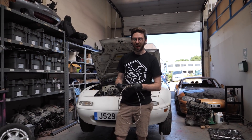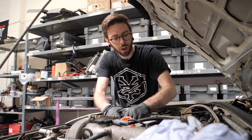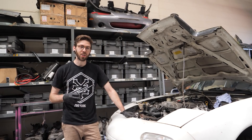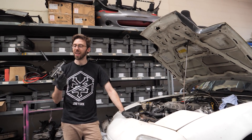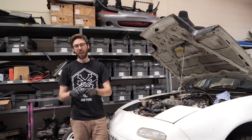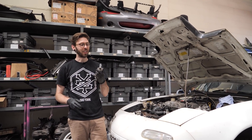So we're back again today and it's time to start fitting all the oil and water lines so we can actually make some boost. So we're going to prime the oil line for the turbo - I'm not sure whether it's probably worth it for a £110 turbo, but in terms of best practices we will do. So I've just found that there are two different holes in the same area which this can be threaded into, except it can't because the thread is completely different and I have completely ruined it. So top tip - make sure you get it in the right hole. I'm now going to go change this fitting out for the correct one and try again.